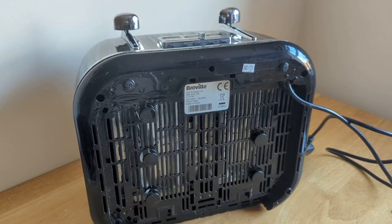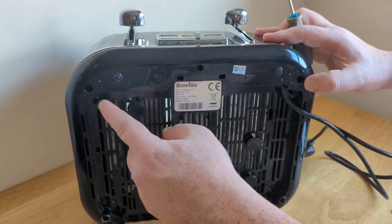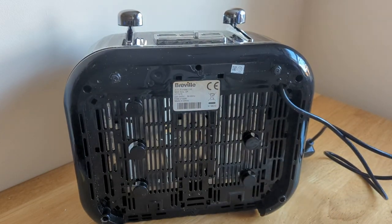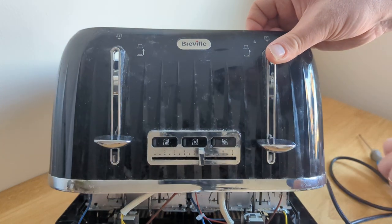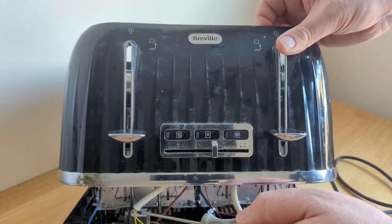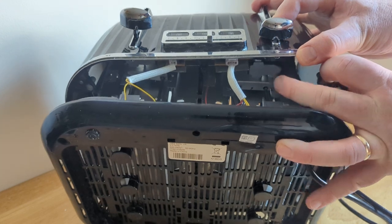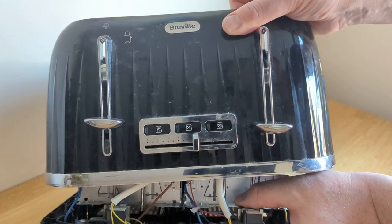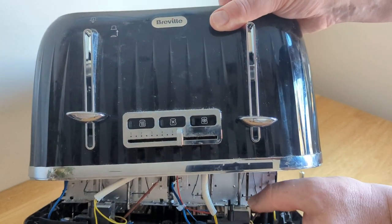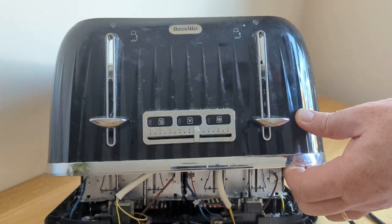These have got a lot of screws but you don't have to take them all out to get to the crucial bit. I've taken three screws out in total from here and left the others in, because you only need to get to the key point of the toaster — which is basically these two sensors down here. When these levers are pushed down, there's a plate that pushes these little pins down, which then connect with the sensor. What's happening with mine is this area is totally covered in breadcrumbs and dust.